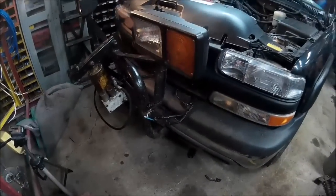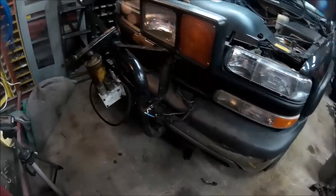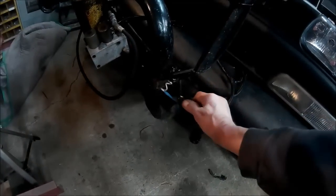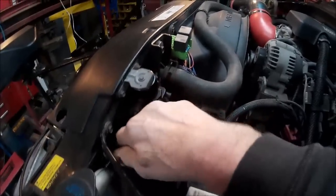All right. We've got the wiring job all done. Our plow lights and truck lights are operating correctly. We have our weather pack terminals so that we can unhook things. Everything's run inside of a loom. Weather pack over on this side. And everything is inside of a loom, so that it's well protected.